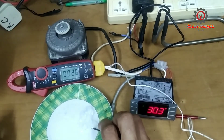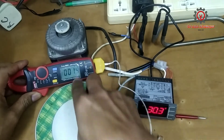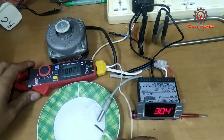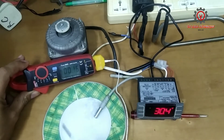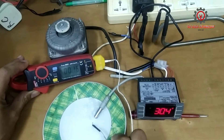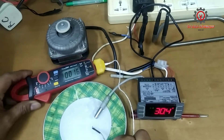Let's take a measurement again. I add a little more ice on it. Now I got 15, 14 degrees Celsius. Let's try to dip the evaporator sensor into the ice water again. I set that to 15 degrees Celsius. I'm measuring 14 to 15 degrees there — see, the fan motor activates!